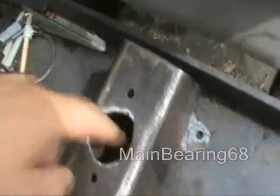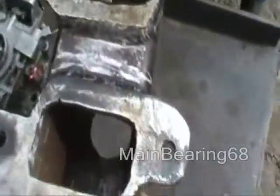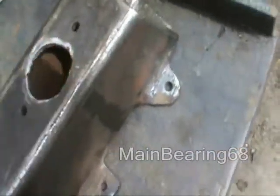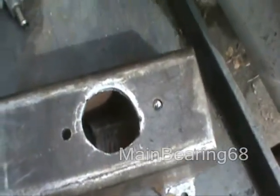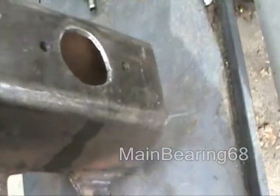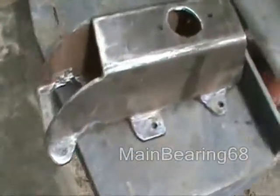The reason that's not already in there is because I think it's got a crack or something in it. Anyway, we'll talk about that later. The intention today is to put a baffle in here so that the gas fumes don't go straight into one particular hole or favor any particular one. Our intention is to put a baffle under the carburetor. I've just seen a lot and worked on a lot of cars, and in my estimation and experience, I think that's the best thing to do. If you have a better solution, by all means — this is a prototype. But if you have a reason to believe we're doing it wrong, rather than just criticize, please tell us a better way. Our intention is to put this on there and get it running.